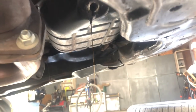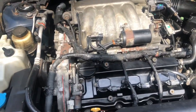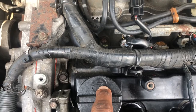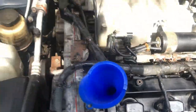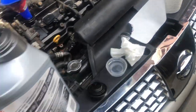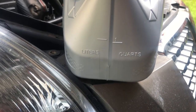This is about the point where you can just go ahead and put it back in. Then you're going to go ahead and tighten that back in there — make sure not to overtighten, but make sure it's tight. Then finally, you're just going to identify where to put the oil. Usually you can tell where the yellow dipstick is, where the actual engine is, so the cap must be nearby. You can also identify it just by looking. So I'm just going to take the cap off — look how empty it is in there, it's clean in there! Put your funnel in there and then ultimately just pour your oil. This engine takes four and a half quarts; this is five quarts — that means do not pour all of this in. So as you can see, the quart numbers — we're going to be right at about four to four and a half quarts.